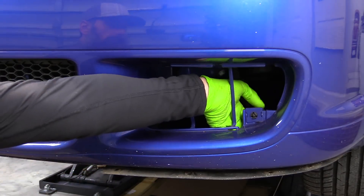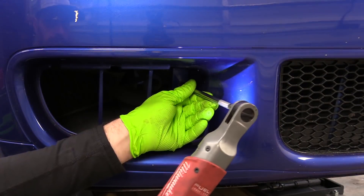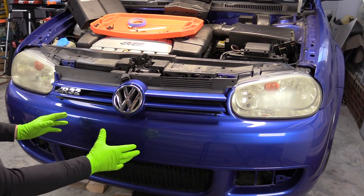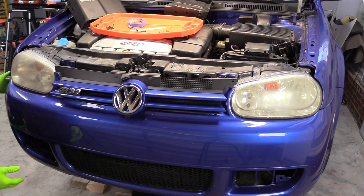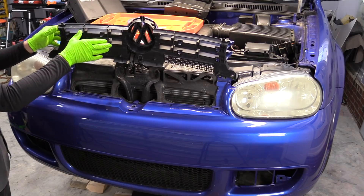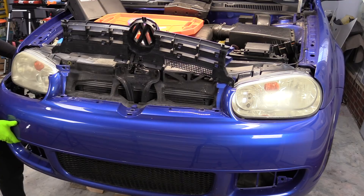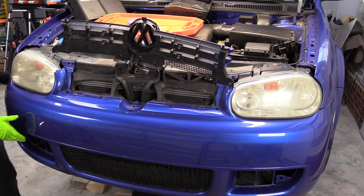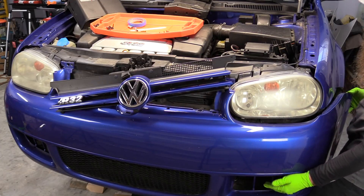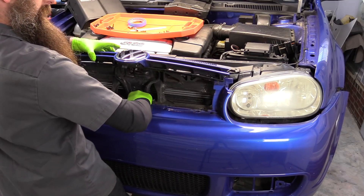On the driver's side, go ahead and reach back and pull our ambient and temp sensor out. Do the same thing on the passenger side. Next, what we're going to do is pull the bumper cover away from the car a little bit because we still have to disconnect our side marker lights. I'm also going to flip this front grille up so it's out of our way. Slide it forward, reach down, disconnect the side marker light. Slide it back on, reach down, disconnect it. If you didn't do your ambient temp sensor, do that now. Come to the front and slide your bumper cover off.